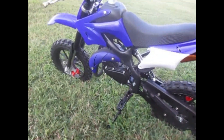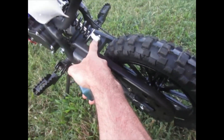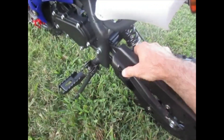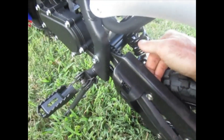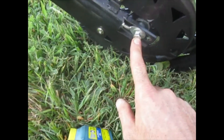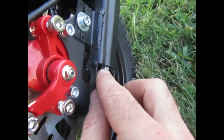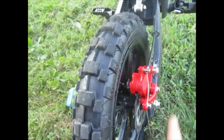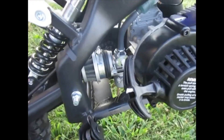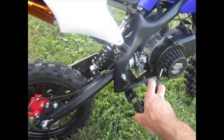To assemble you also do the handlebars, the swing arm to the monoshock, and the stickers — I haven't put those on yet. The chain is loose right now, but when you sit on it, it tightens up. When I took this out of the box the chain was way too tight, so I'd recommend loosening your chain by loosening the axle nuts and backing them off a little — that allows the rear wheel to move forward, loosening the chain. You don't want to damage your engine or transmission.